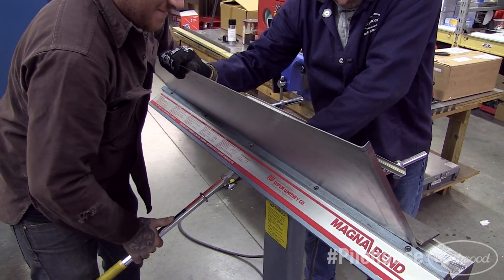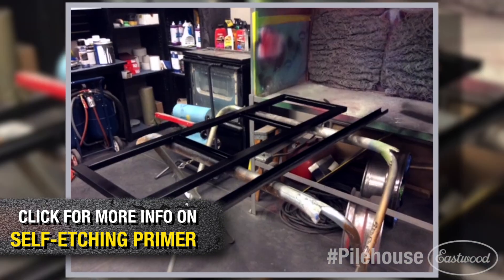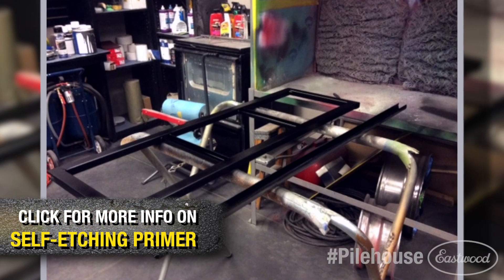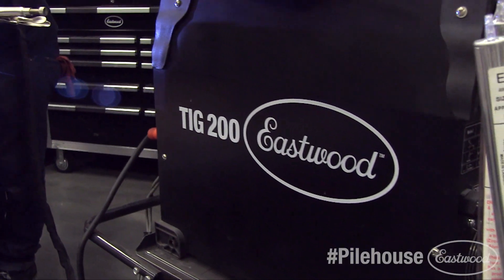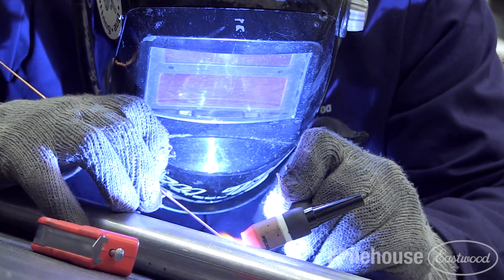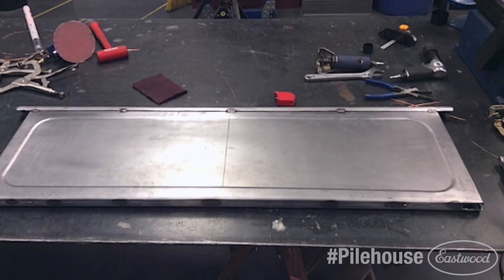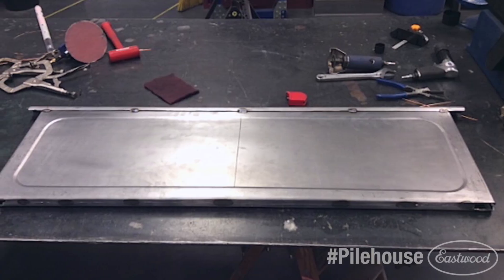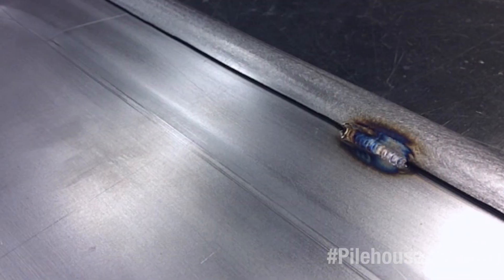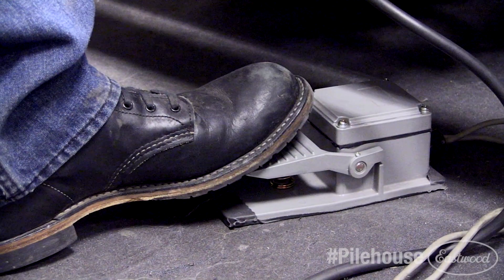With all of the parts built and test fit together, we took everything apart and I applied three medium coats of self-etching primer to the sides of the pieces that would be hidden when the tailgate was finished. I then reassembled all of the pieces and welded up the seams to make the outer skins one piece. I also added a number of short welds to connect the top tube to the skin to keep the tube from moving or warping from lifting on it over time. A small bead of seam sealer will eventually be added to this seam to seal it all up.